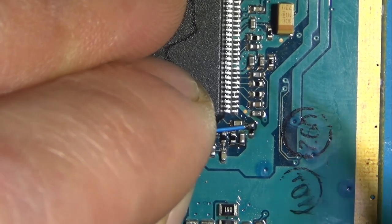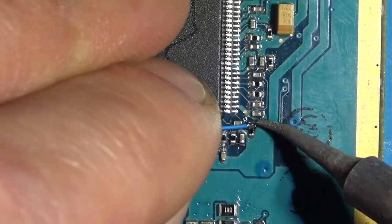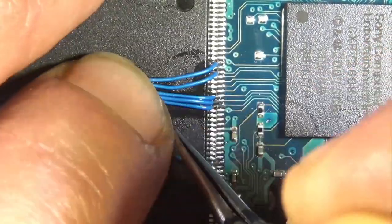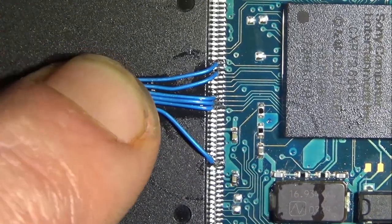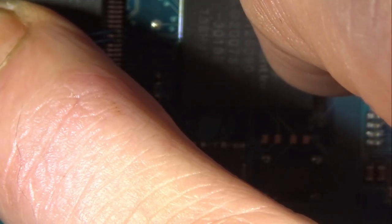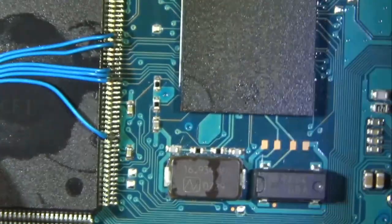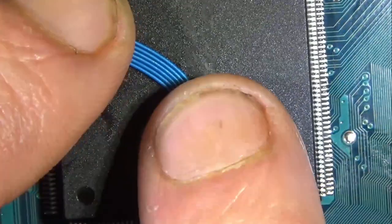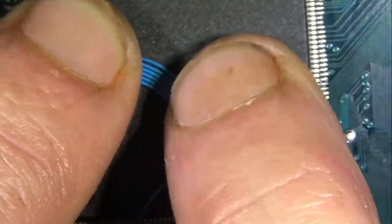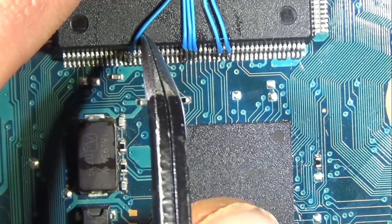This is the SX point — responsible for PS1 playback. However, it's totally unnecessary with the way I set mine up, because I flashed MechaPwn, which I let handle PS1 region-free and backup support. MechaPwn actually handles PS1 better than any of the mod chips. Typically you just press Start to disable the mod chip and let MechaPwn take over, and it'll still work even if you don't solder that wire.